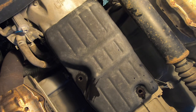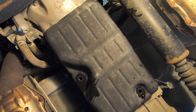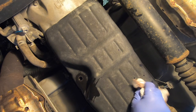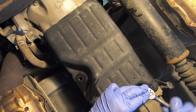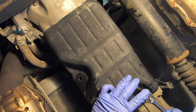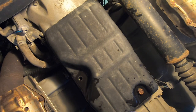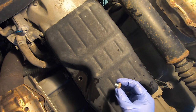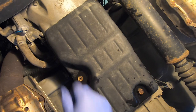I've put a new crush washer onto the drain bolt. Reinstall the drain plug — not the check plug — and tighten that down just snug. Then loosely reinstall the check plug without the crush washer, just temporarily, screwing it on lightly with your finger.